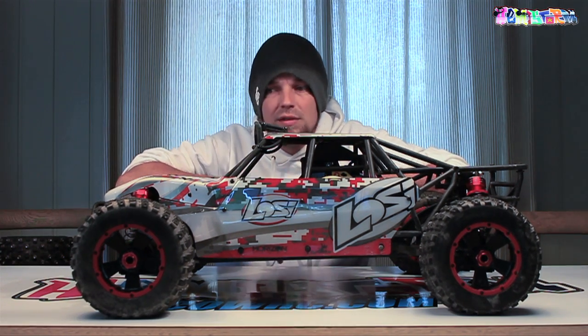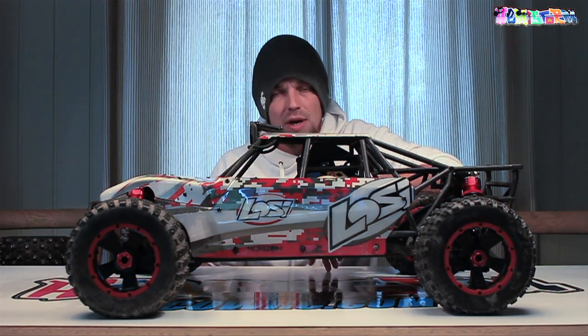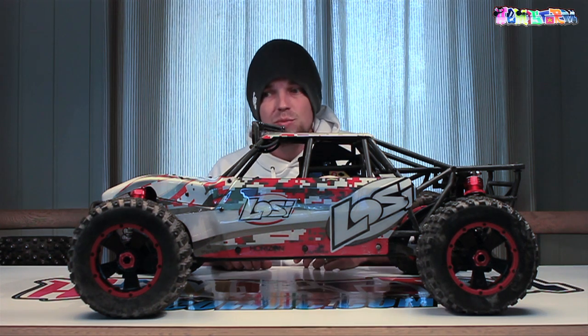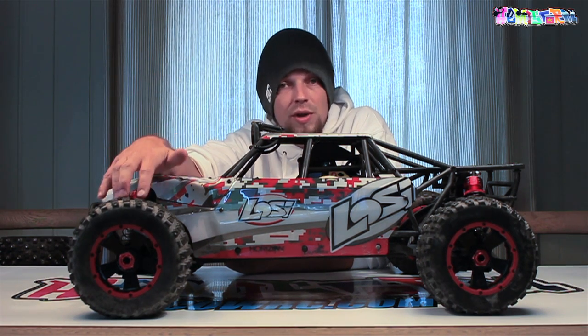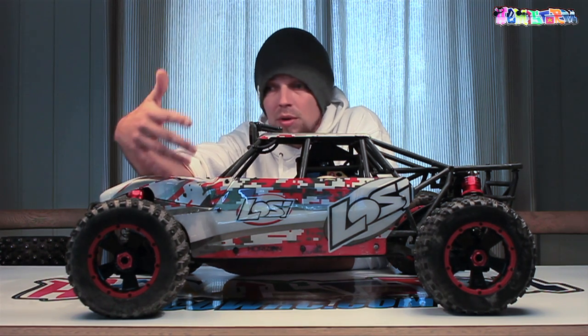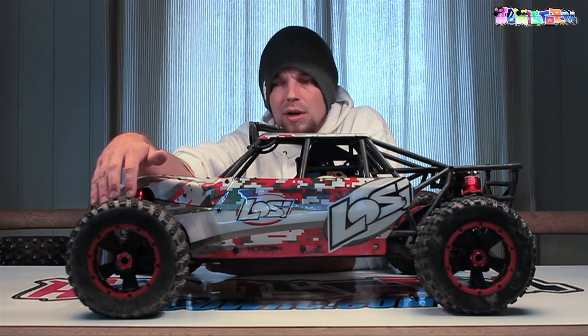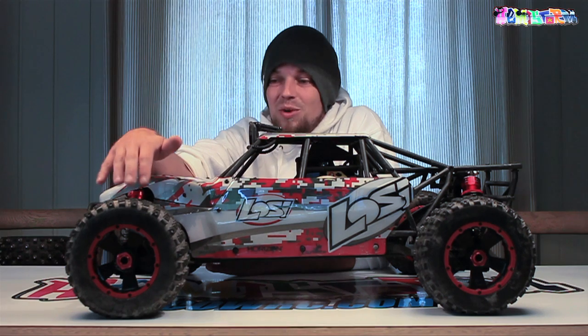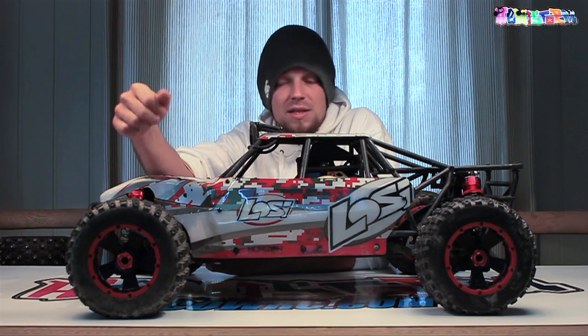This video is going to be about wheels and tires. I had a problem with these wheels right from the start - not because of the way they perform, but because of future maintenance. These rims have a different layout. A few people said you can just switch out to Losi and HPI rims, which is true, but the rims that come on the DBXL would not accommodate a Losi 5 or HPI Baja tire foam, beadlock, etc. So you're stuck with this rim, these beadlocks, and these tires - something I want to avoid in the future.